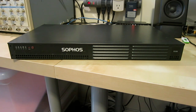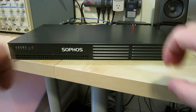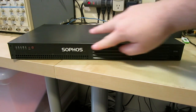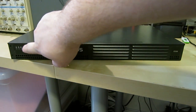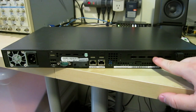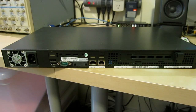You'll have to excuse the banging in the background — that would be the birds attacking the bird feeder. I don't know too much about this model. I've read documents online; it just says ultra-low power Intel processor, which probably means this is an Atom-based motherboard. There's no fancy display on the front, but there is a nice angled grille for air intake. I didn't see any fans when peering through. Simple controls, two NICs, a hard drive access light, and a temperature warning light. On the back, this particular one doesn't have an expansion card installed — two network ports, a covered-up video port, serial, USB, and standard power.